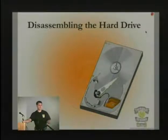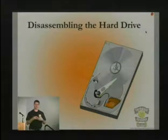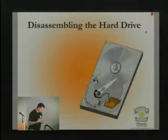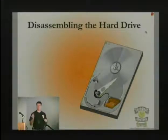But one of the other things that happens with a hard drive, when the platter starts to spin, the manufacturer already knew at the time that they were manufacturing the hard drive that there were going to be little fragments that were going to come on and off of the platters. And when they start to spin up, it creates an air bearing, and it flings those pieces off of the platters. In some cases you'll see when you open up your casing, there are little tunnels around the edges of the metal of the casing, and they're basically there to capture little fragments as they fly off. They even have a little filter, and it looks like a little tiny pillow.